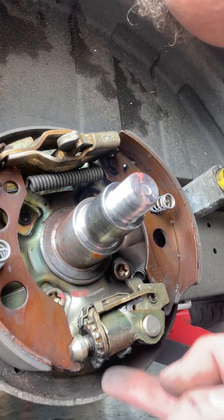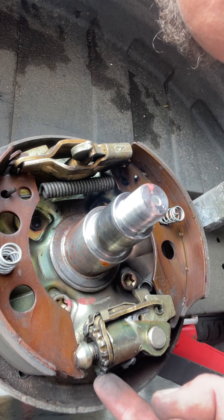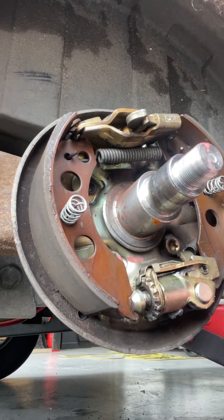I've got the brand new one there that'll be put back on when I build it back up, and then it'll be torqued to 280 Newton metres and the paste applied. We then set the brakes up with the little adjuster bits there - you do that from the back and you basically only want a slight bit of bind on the brake. Then at the other end of the brake cable you test for 10 millimetres of what they call free play, so you can move the cable - that's how you know they're not set too tight.